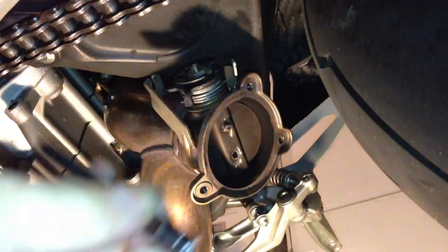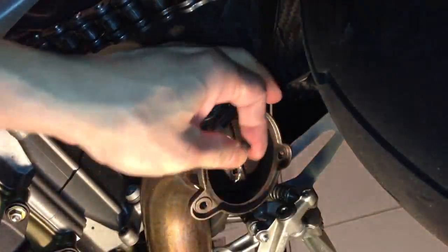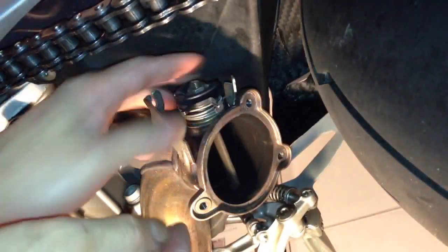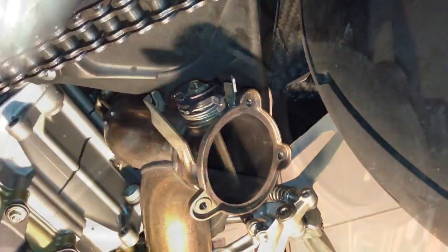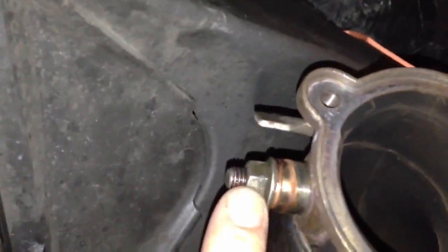That's still tight — socket. I totally removed this flapper valve, as you can see here — it's very clean. I've used this bolt and nut, the size is 12 millimeter. I have a crush washer — a copper washer — so it's sealed off, so you don't have any exhaust leaks.